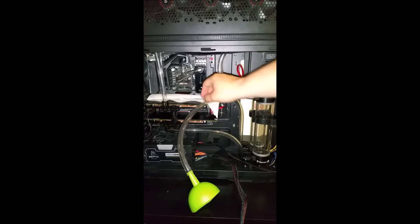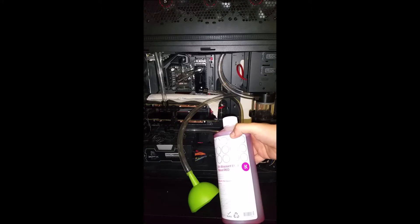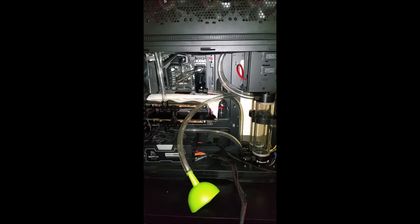What we're going to do is power the power supply on and off to turn it on. I went ahead and connected the first pump that we'll be turning on and filling. You don't want to dry run your pump, so make sure that only the one you've got connected is working. Here's the fluid we're going to be using — it's some blood red EK, non-corrosive, non-biological, and also non-conductive, which is nice.